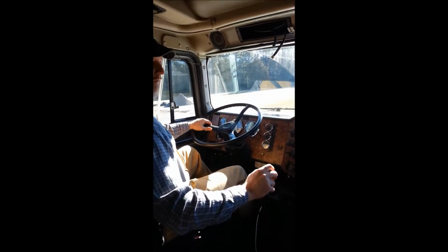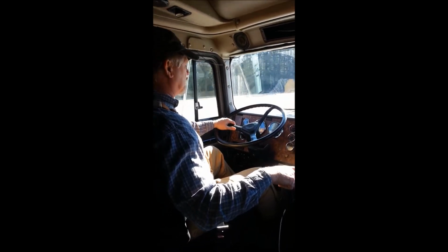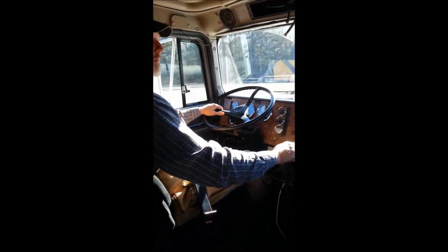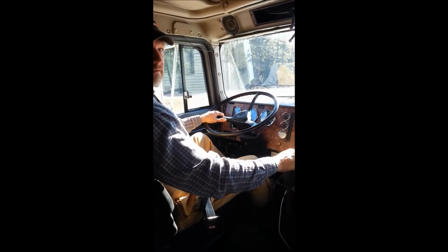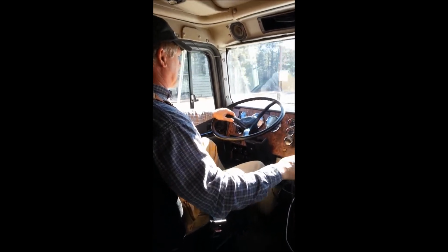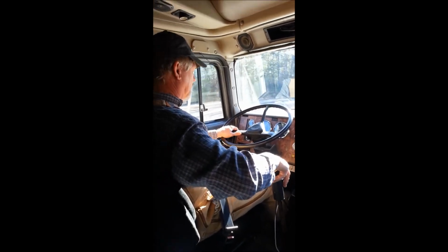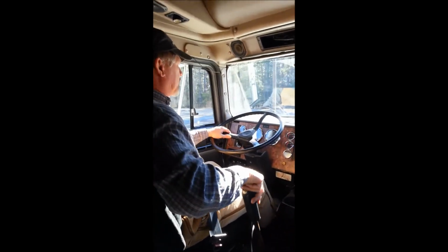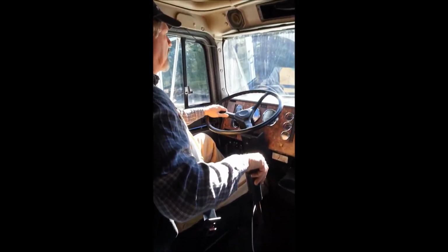Come back up on the clutch, not off of it. Just come up to where I'm in the free play. Okay, just letting it engage. Now I'm going to blip it and go into the gear. Okay, then I let the clutch ease back on again. And I'm in my next lower gear. I want to go down to 6th, okay? I'm down below 1100, clutch and lever into neutral, get my gear lever lined up, clutch is up, blip it, clutch and lever into the gear immediately. Let out. Okay? Everybody got it?